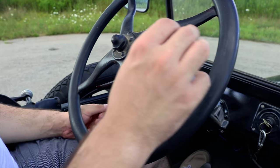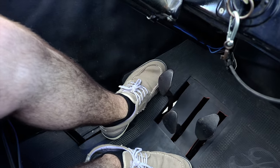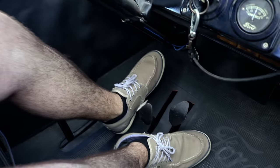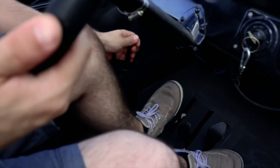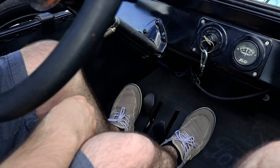We've gotten her started and increased the spark to make it run a little smoother. You've got your throttle here, your lever here, and your three pedals. First, put the lever in the middle to go into low gear, then engage it by pressing the quasi-clutch pedal. Give her a little gas and let that go. As you get moving, increase the throttle a little, throw it into high gear, and let off the clutch — away we go in high gear. When coming to a stop, decrease the throttle, pull back into low gear, and you've got your engine brake right there.